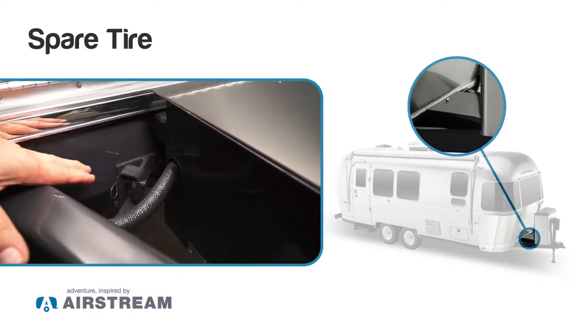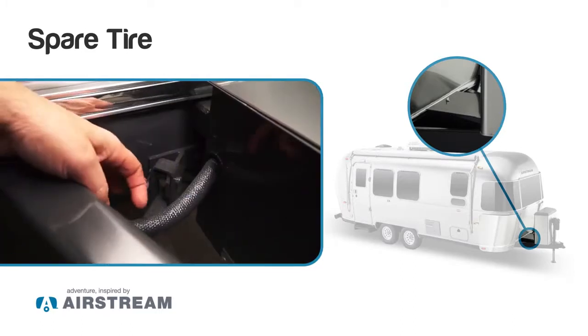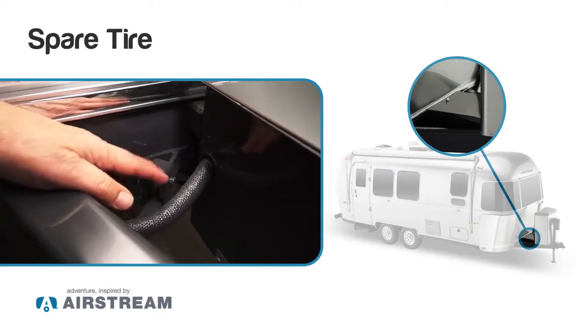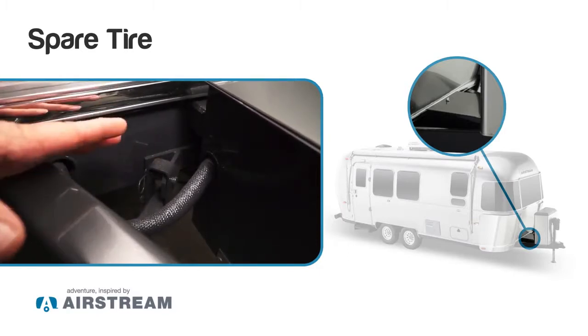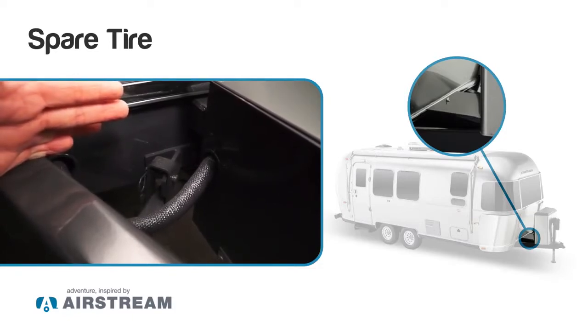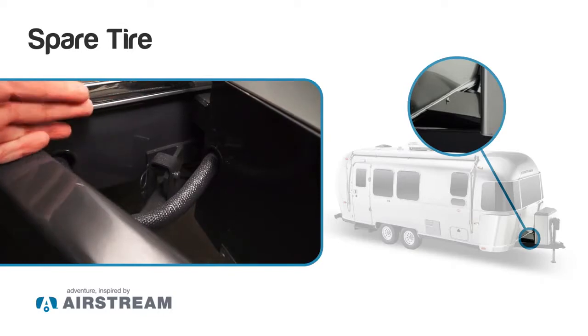Just pull out the cotter pin, the top key, and then that'll drop down and you can pull the tire out of that. Here's the location where you pull this cotter key out, and you can pull that pin out, and the spare tire carrier will drop down. When you're out along the road, it's better if you call some roadside assistance to help you with a spare tire, due to the uneven ground you may be on. It's just a little bit safer.